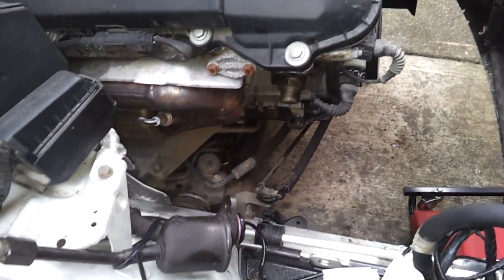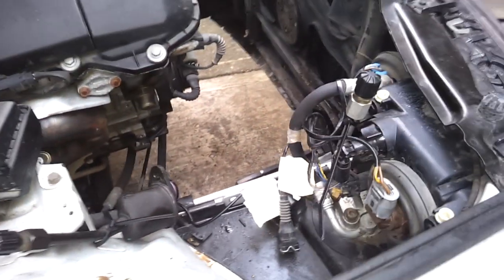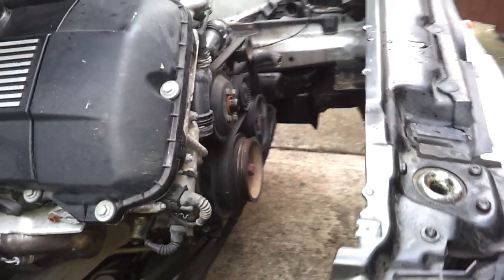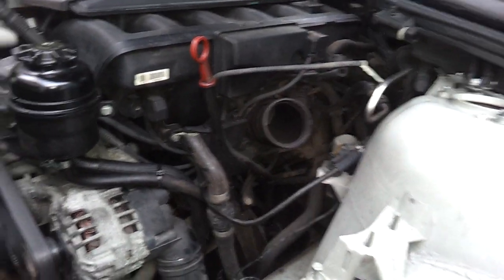On the car itself, last weekend I got stuck in and stripped out the air conditioning pump and tied off the pipes, stripped out the entire cooling system — radiator, hoses, filler bottle, all that kind of thing. I can still start and run the engine because I need to be able to move the car around. Also took out the airbox, air cleaner pipe, ducting, air mass meter — all that stuff is gone. That allowed me to measure up the distances between the front crossbeams to send to my fabricator guys to get the front battery box made, which is hopefully going to be done within the next week.